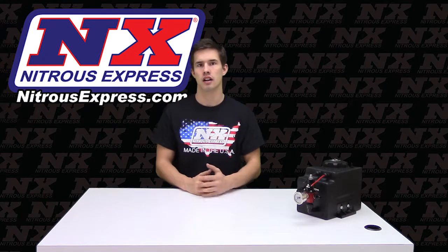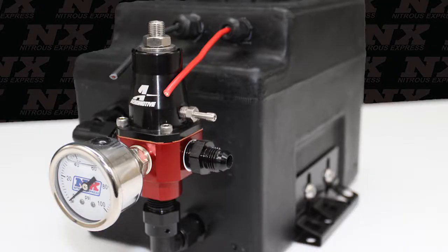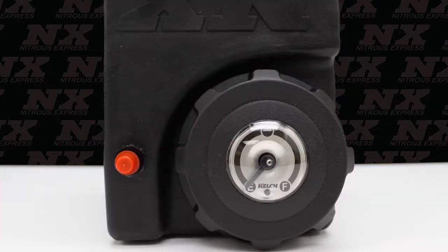The Safe System includes an integrated fuel level gauge and all mounting hardware for no-hassle installation. The regulator is boost referencing at a rate of 1 to 1 for boosted applications. The fuel pressure can be adjusted from 3 to 60 psi with no special jetting required.